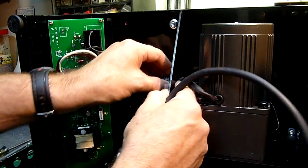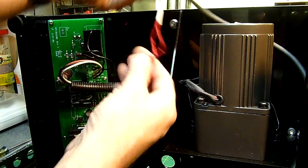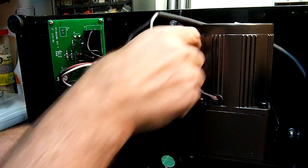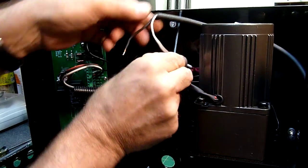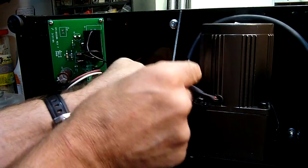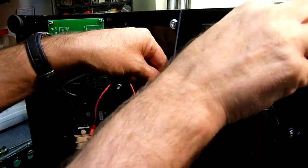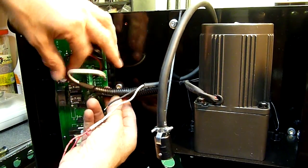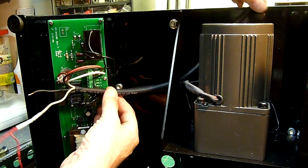What I want to do is pull this corrugated tube off there like that, and position the cable like that. The first thing we have to do is carefully snake these clip leads through this hole — the hole is plenty big enough if you're careful. So there's one, and there's two, and get the ground lead. We want to stretch it out so that it's about the same length as where the motor cables come into the control box, which is right about there.